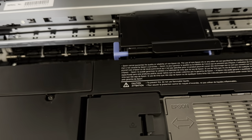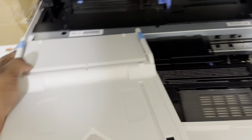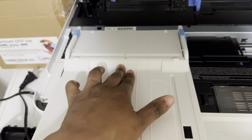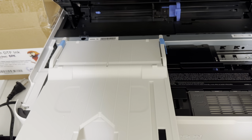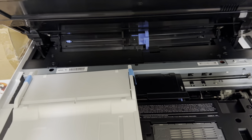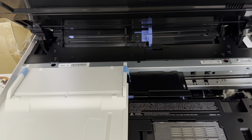The guy who made the video shows how to remove the rolling tray that is in here — you want to remove this because when you go to print and the film prints out, that dip right there is going to cause your ink to smear. So you do want to remove that tray so that you can build your own loading tray when your film prints out. I have not done that yet but I will be doing that as well. There is a lot more to this printer, but I haven't really set anything up. My biggest thing was getting the rollers out because I was afraid that was going to be a challenge for me. I'll keep you guys updated and show you further what I do with it.